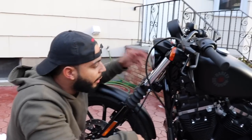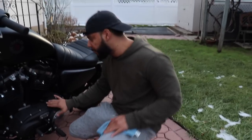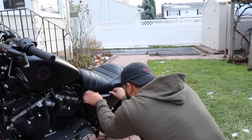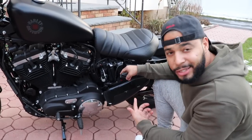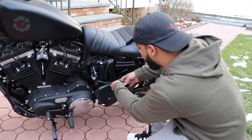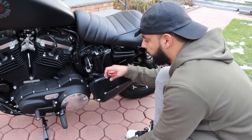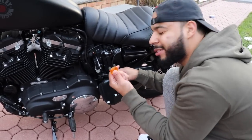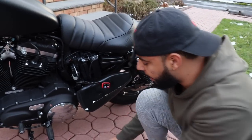Things are electronic here so we're gonna disconnect from the side. Open the side cap right here — this is where you'll find your connection with the battery and everything else. We're gonna disconnect this from the sides. Take out that orange plug — that's the main source, the one that gives power to your bike from the battery. That's number one knocked out of the way.